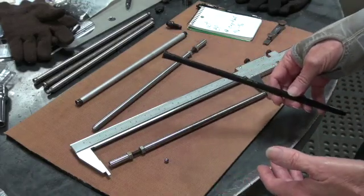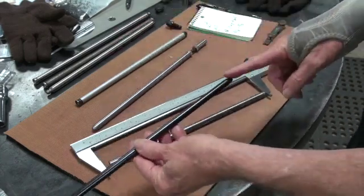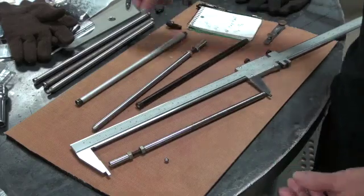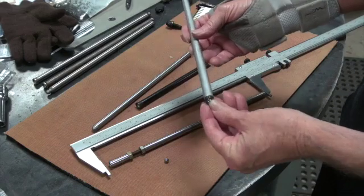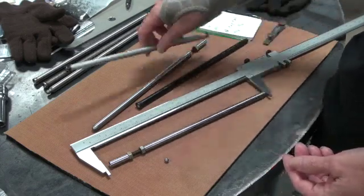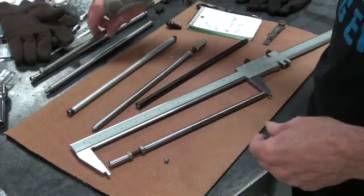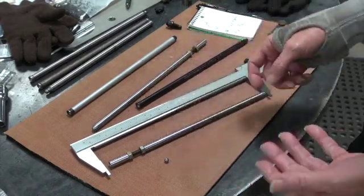In your application, you'll have to tell him your cup and ball, and you'll be using a 5/16 ball, 5/16 cup. Some roller lifters in the old days had a 3/8 ball on the bottom, because this is pro stock stuff from the 70s. That's D&D, and I think this is a D5 Chrysler Hemi, and it's 3/8 ball on the bottom too. So that's why you have to specify 5/16 on the bottom, 5/16 on the top.